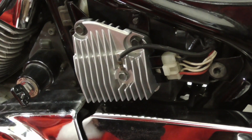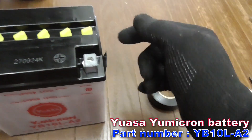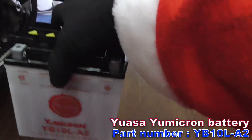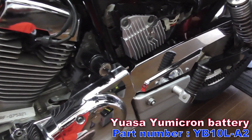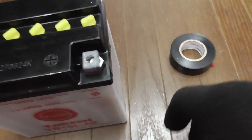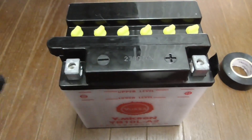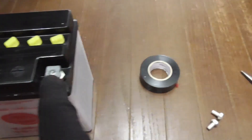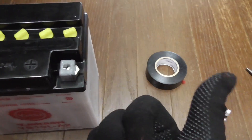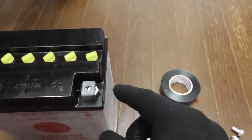And that's it. It's pretty easy, isn't it? Let's install the new battery and see how it goes. A little helpful tip on your battery — I have placed a little tape here. Because the battery is going to be installed in angle, since the bike is on a side stand. And then you have a nut inside of these terminals, and you don't want those moving out. That nut is going to be moving out of the battery and just fall. So I have this tape to stop that.